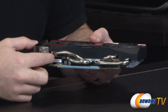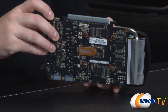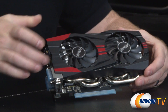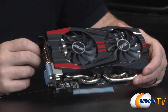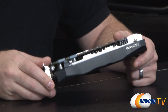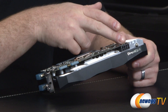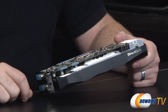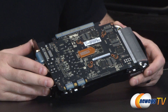The super alloy power components have a heatsink directly connected to the PCB of the graphics card. If you ever need to remove the cooler unit, you only have to remove four Phillips head screws, which allows you to pop it up if you want an alternate cooling solution like a water block or just need to clean it out. You also have an eight-pin PCI Express graphics connector — make sure to connect that from your power supply or use the included adapter. An eight-pin delivers the same amount of power as two six-pin connectors.